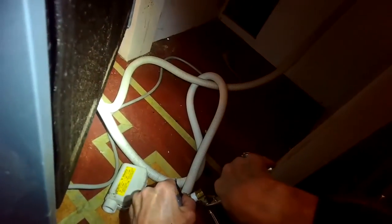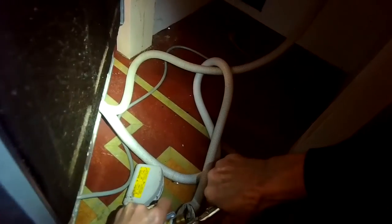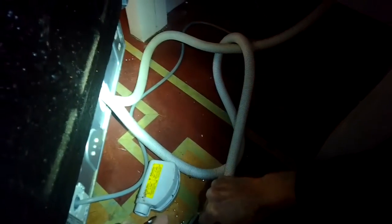This is a compression fitting, so you don't have to put on any kind of thread tape. You can just put it in position, tighten it, get it snug, and that'll be nice and watertight. Probably only about 10% of the applications I see are this one where it's all connected behind the dishwasher. Usually there's access to all this stuff right underneath the sink, which makes it easier.